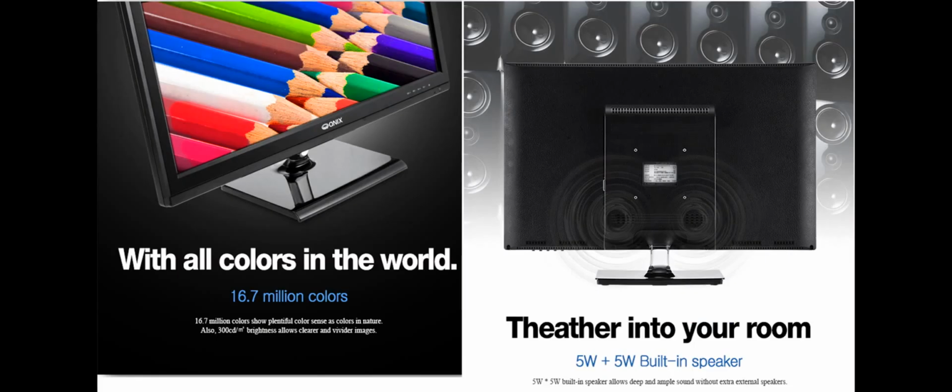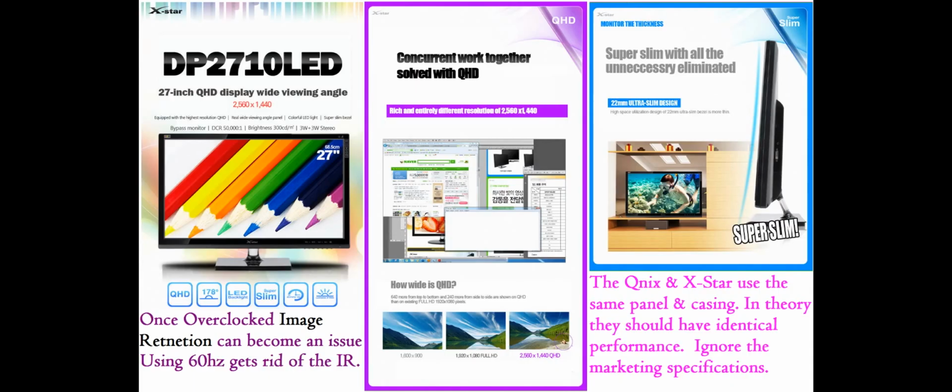Many people have reported getting image retention once they overclock their panels, so be wary that image retention may occur. Both the Qnix and Xstar are known to overclock to at least 96 Hz, and many people get theirs up to 120 Hz. My unit also suffers from image retention once overclocked to 96 Hz, and I found that setting the panel back to 60 Hz for a while would get rid of the image retention.